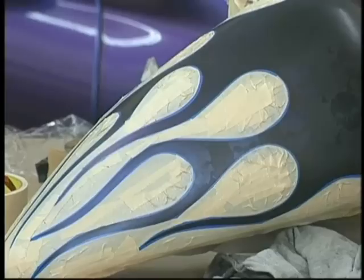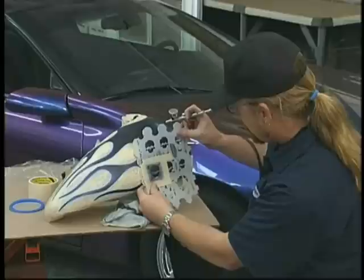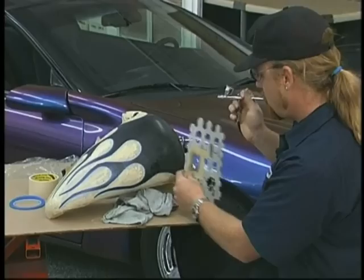You're not going to notice it as much as I get to the end because we've already fogged the tips of these flames with the color. This color will reach what I like to call a ceiling color, like a final color. You get it so dominant, it can't get any darker. I want to make sure I don't get all of this area too dark, otherwise you'll never see these skulls later on. The cool thing about the chameleons, much like the candies, is they're so transparent, I'm always going to be able to see through the shield semi-decently.